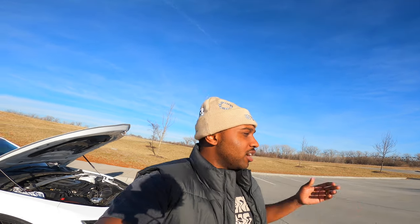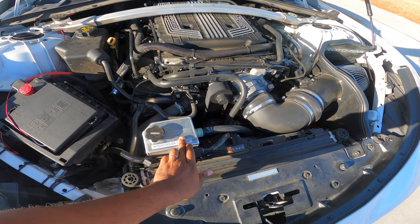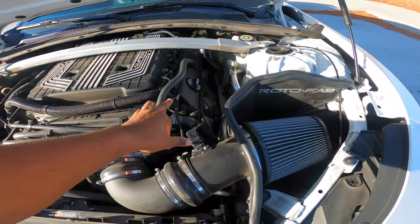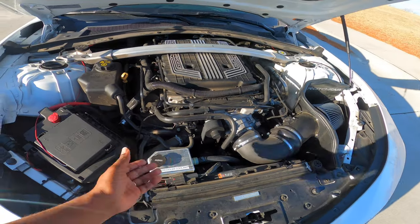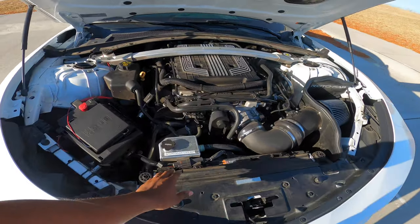But it's like, bro, if you actually did preventative maintenance, which is do your oil changes, your diff fluid changes, change your brake pads and all that, but bleed your superchargers. Or you can get one of these that bleeds it for you. So this is a coolant reservoir, and this bleeds the supercharger for me, so I don't have to constantly hook up to this and bleed it manually. This does it by itself. It keeps pressure in the head of the system, and also keeps another extra gallon of coolant in there. So I would recommend either bleed the superchargers or get you a coolant reservoir.